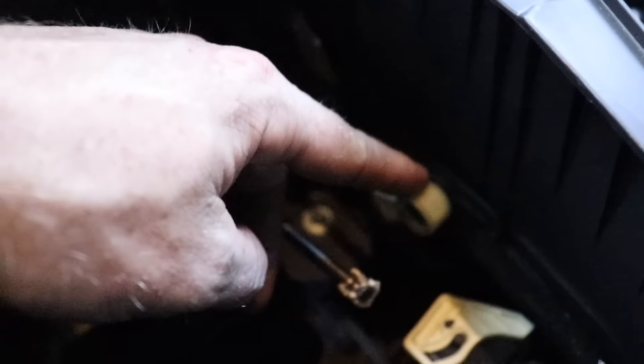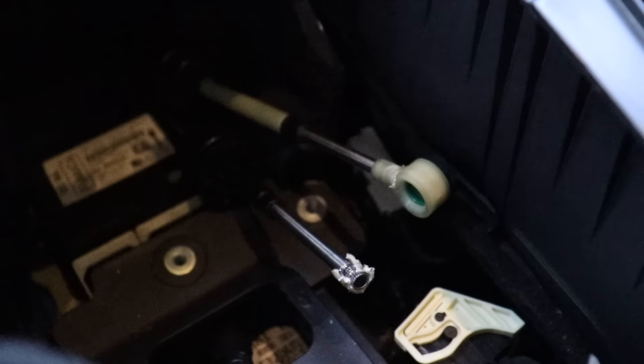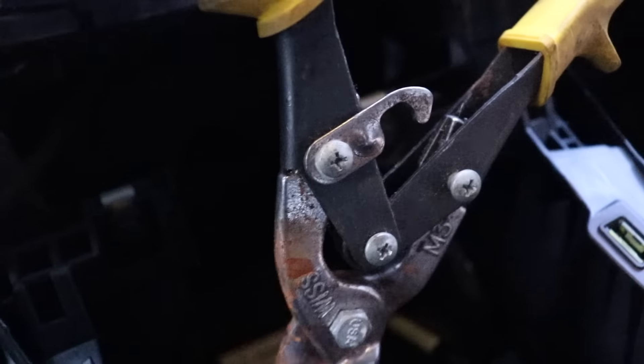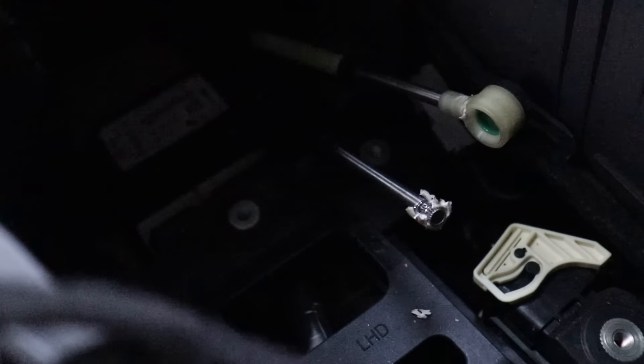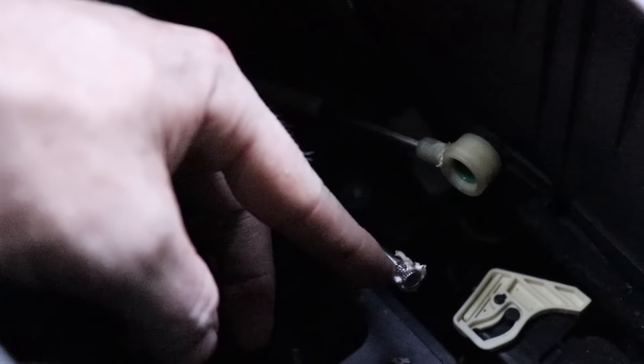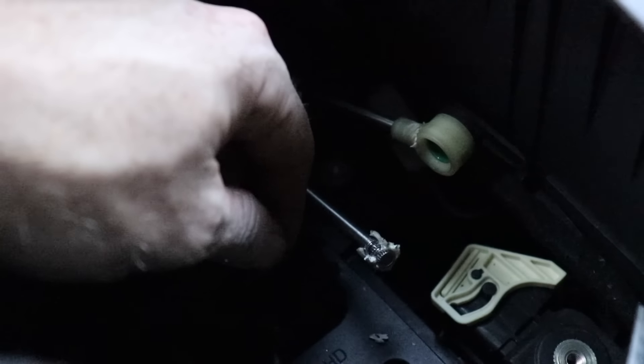As instructed by the manual, you have some metal pieces — I'll call them clamps — that go on this end instead of the plastic, giving you a better shifter feel. I am just using a pair of tin snips. Your best bet is probably a Dremel — that's probably your easiest option — but right now I'm using rusty tin snips. Pliers did not work when I tried them. You're going to need something to actually cut in, because this is molded or adhered in a way that you need to cut it off. It's going to take you probably 15 to 30 minutes to get this off, but I do believe it's worth it to get the metal clamp pieces on.